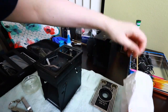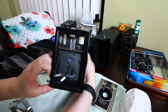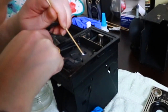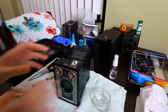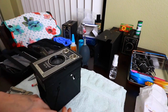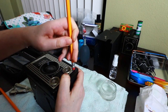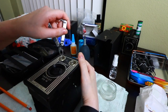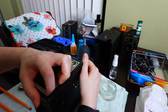While I'm in here I want to try to clean the lens behind the shutter. Let's put it on bulb mode and put the light in through here — see all the dust? I'm going to open it and hold it open and then dry softly. I screwed the first three screws back in, and for the last one I used a pencil eraser to get it started and help get the tiny little pins in there, then use the little pliers to finish and tighten them up.